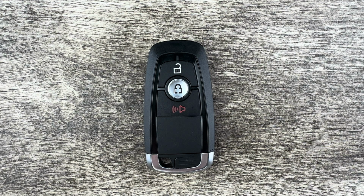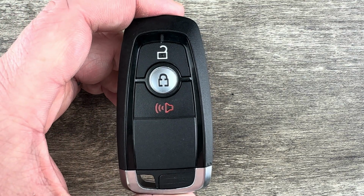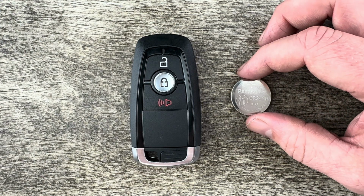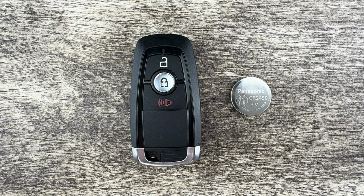Today we're going to take a look at how to change the battery in this Ford Fusion remote key fob. This Ford Fusion key fob is going to use replacement battery CR2450, and I'll put a link in the description box of this video to where you can find these replacement batteries if you're in need.